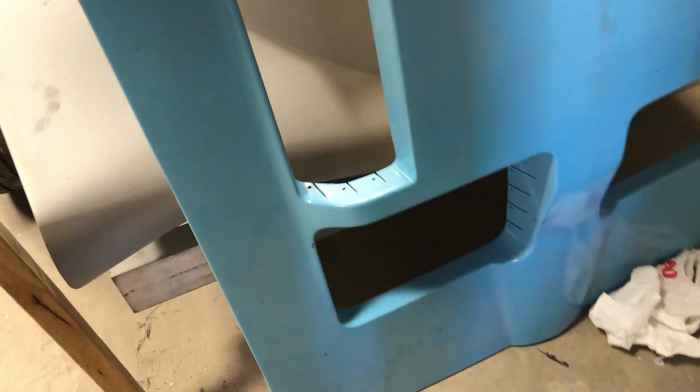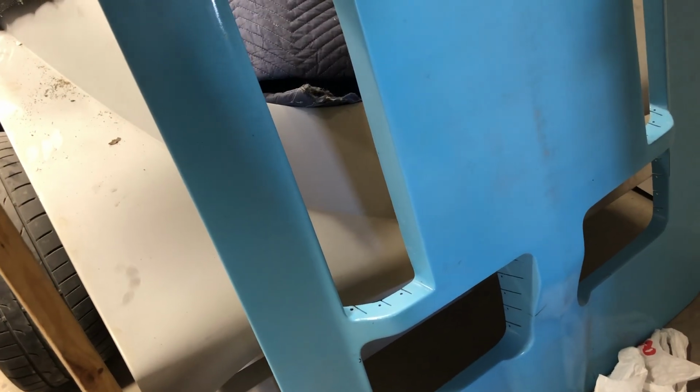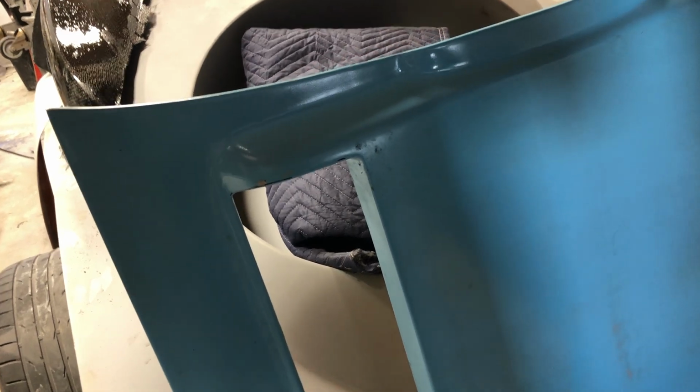All right, so when I get a chance, I'll weigh this and see what it weighs. But it's not an apples to apples comparison, because it is the full hood plus the supporting frame around it, which I do not have on the other hood, because the other hood uses the C6 supporting framework, which is the factory sheet molding compound, which I found is surprisingly heavy. Even though it looks like plastic, compared to carbon fiber, it weighs a lot. Probably even with fiberglass, but compared to carbon fiber, it is heavier.